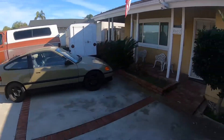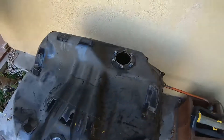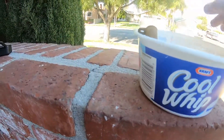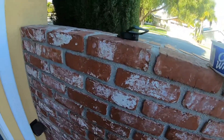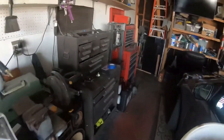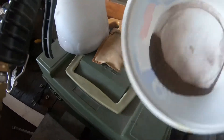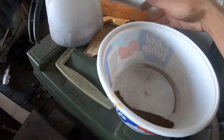So I pulled the tank, and lo and behold — you probably can't see in there — but this thing inside is just rusted beyond belief. I pulled the fuel pump out, and the fuel strainer wasn't even attached to the fuel pump. Here it is right here — look at how much rust is inside the strainer after it dried out. Wow, that's crazy.